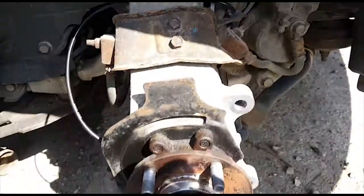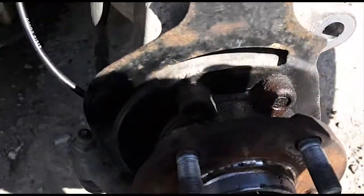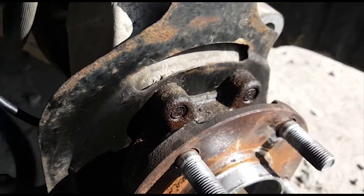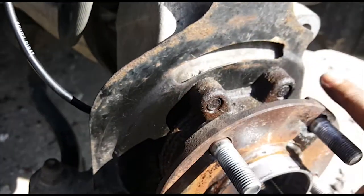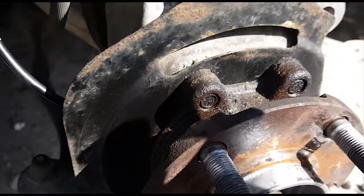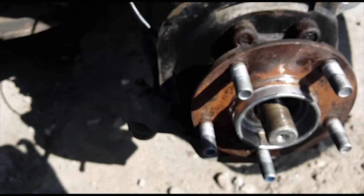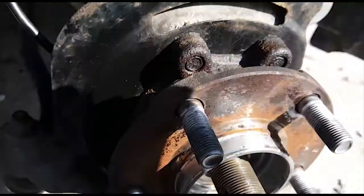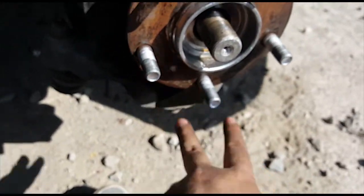And yeah, you really want it out of the way, because you're gonna have to. The next step is basically to get 4 bolts out. It's super difficult to see in this lighting. Okay, this, that, and basically all these will hold your wheel bearing on. So basically you got those 2, and then also identically on the bottom down here, you've got 2 down there.